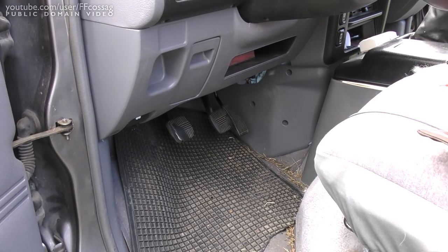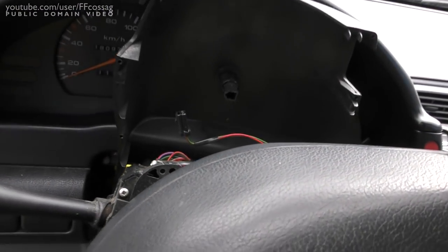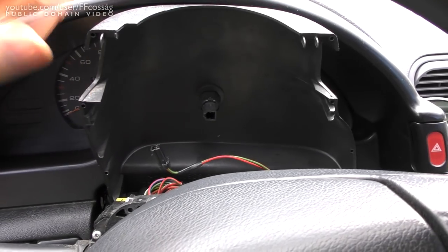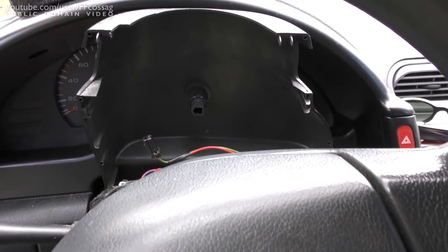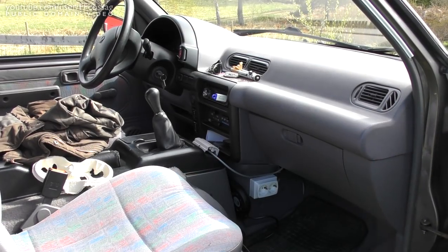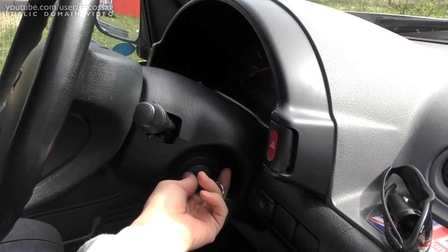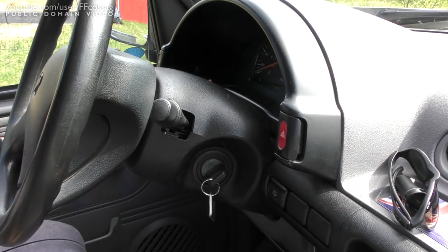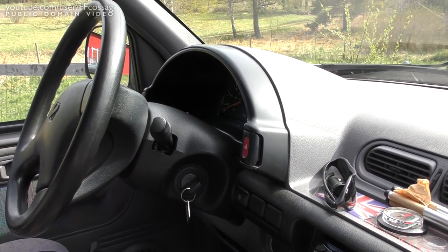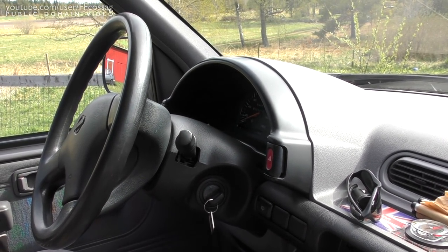I've been digging around the vehicle trying to find which box the LED on the dash is actually connected to, and I haven't been successful. For this repair I'm just going to disconnect the LED entirely — I don't need it. I'll just assume the box is working and if it isn't I can just cycle the key. Now putting this back together and this vehicle's going to be good to go. Everything back together — let's see if it'll still start. Like a dream. We're not going to have an annoying red LED, no more starting issues, and I'm going to feel somewhat confident driving this thing again. Thank you for watching. Cheerio.